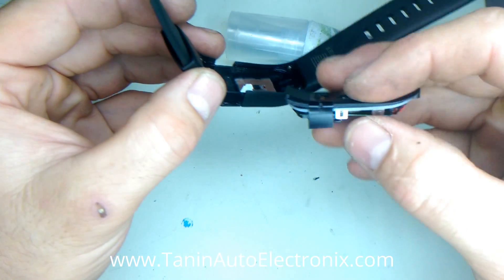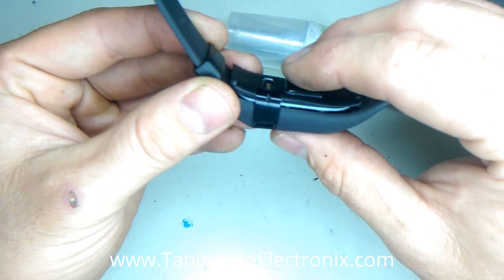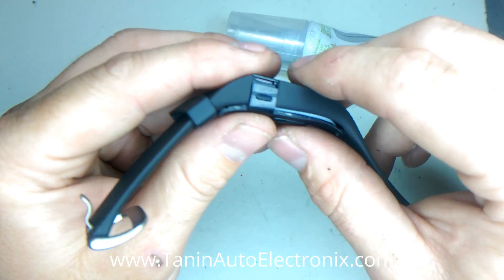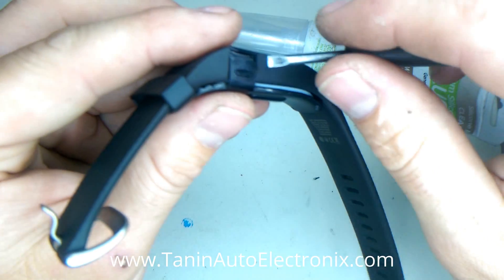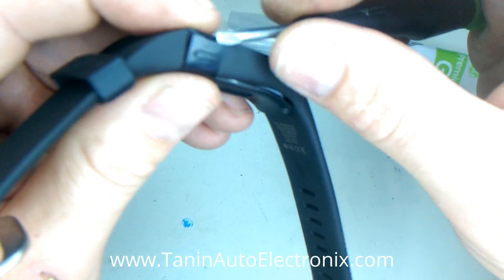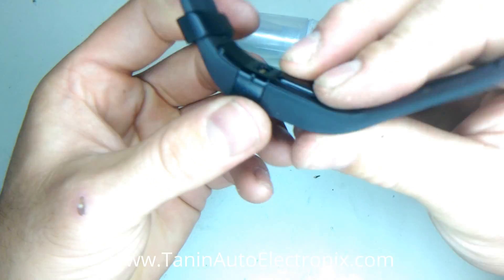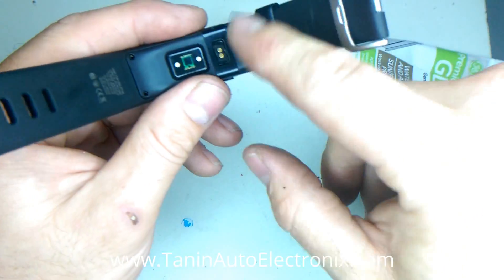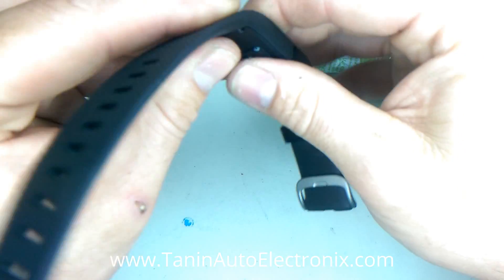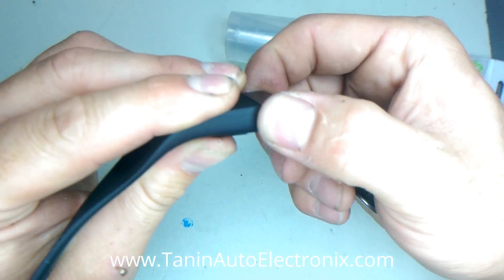Once all that's done and you've put in your new battery, just push this back in place. Watch the button — make sure it doesn't get caught when you're pushing it in. Sometimes you have to pry it outward and push it back in. Squeeze it nice and tight, get the screws back in right away, and then put a rubber band or clamp around it to make sure it's squeezed tightly for 24 hours or so, so the silicone can set.